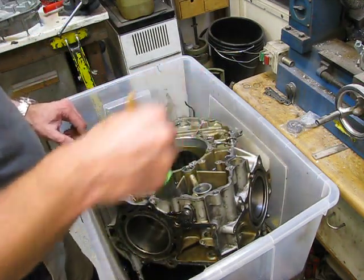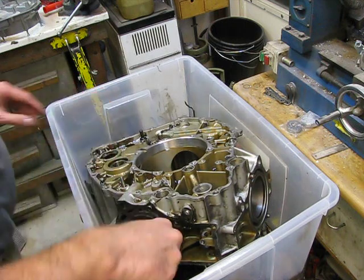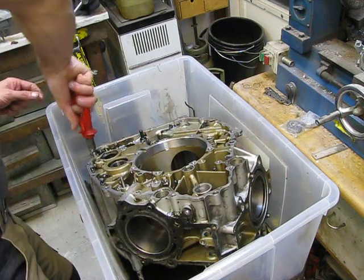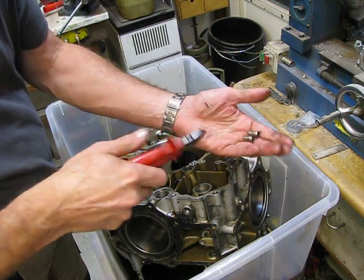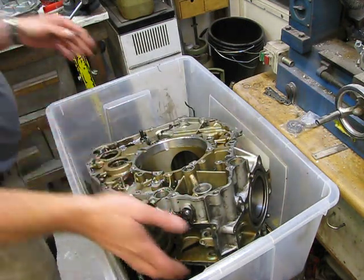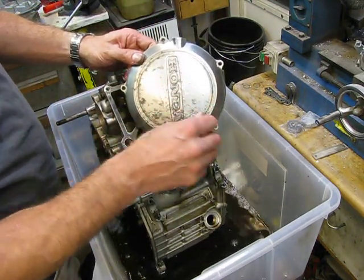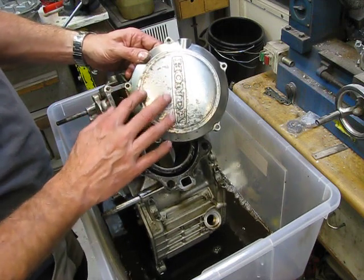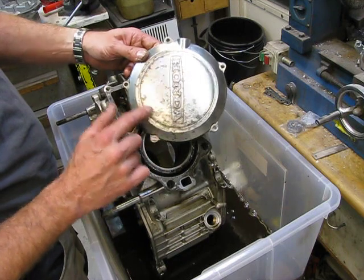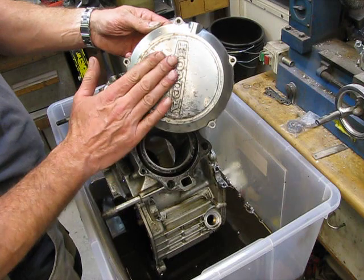It's smelling like hell, I hate it. And then I'm only scraping the surface with a brush and taking out all of the bushings. Those bushings I send to a company that plates them again with zinc — I'll show you later. This one is very nice, and I want to remove the clear coat of it. I don't want to sandblast because this surface is almost clean already. I want to use the surface to polish it again, get out those spikes or grey oxidation, and get it looking like that again. I want to use this for my own engine.